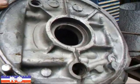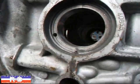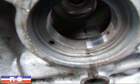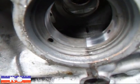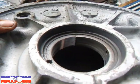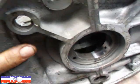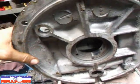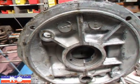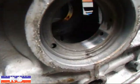This is another block we just ran the boring bar through and it's already been bored 40, but what I want to show you is the bearings and how the case has shifted. You can see to the left there how it's uncut, and up here on the top it's on the right hand side. That means the case has shifted at some point. This is one of the reasons why we made our special jig for putting in shuffle pins, where we actually put six pins in the block to reduce this chance of happening.